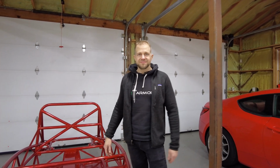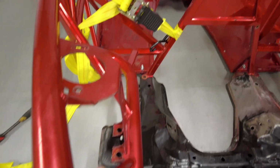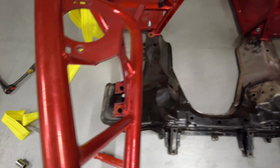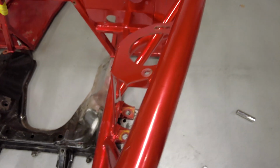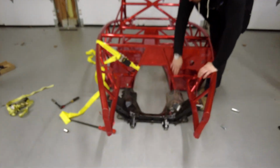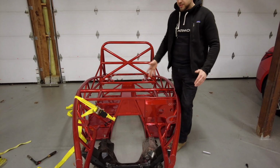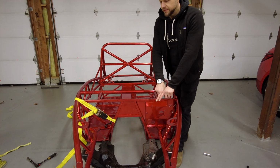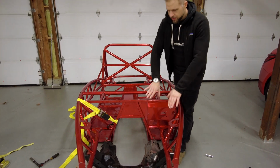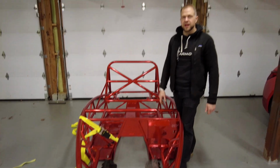It lined up. And one of the coolest things, I think, is that when we did that, these four holes are equally off on both sides in the same direction. Like the whole thing just needs to be spread out. So we're still off a little bit on these, but instead of yanking more on these little bars, because they're just kind of weenie, we're going to start spreading the front and see if pulling this out naturally pulls these forward, because those went back from the impact.